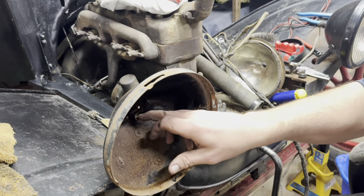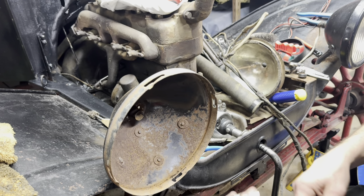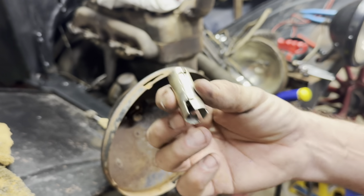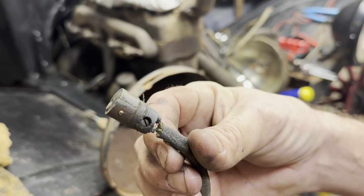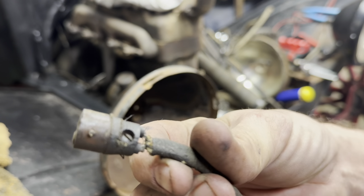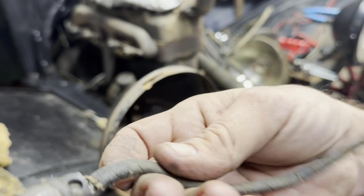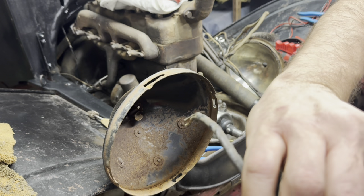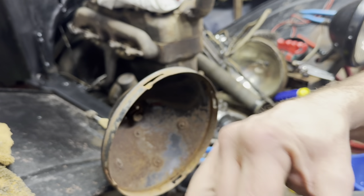What we found was this is actually very simple. You have the socket for your bulb and the connector on the back — it's also really simple and there's no soldering to do. It just has a couple of clamp-downs on it, one on each side. You strip back the new wire, it goes into the socket, snugs down, and that's the end of it. Really simple.